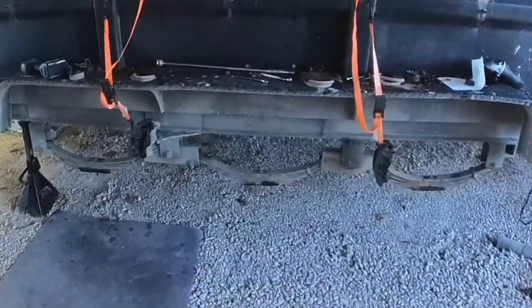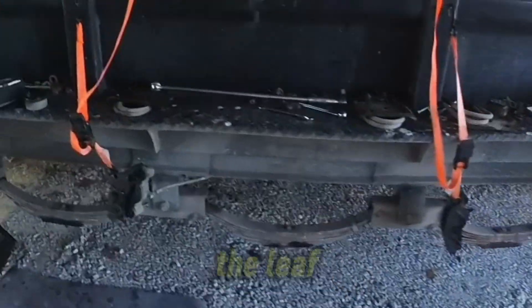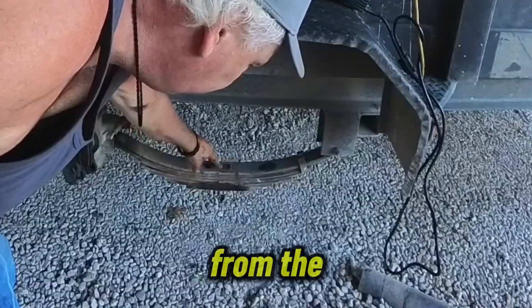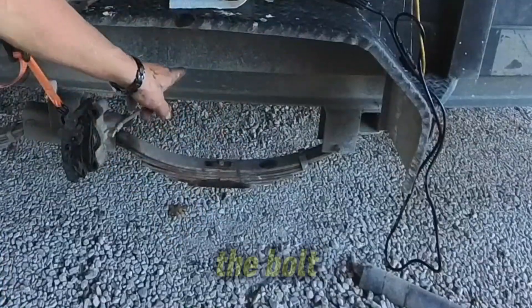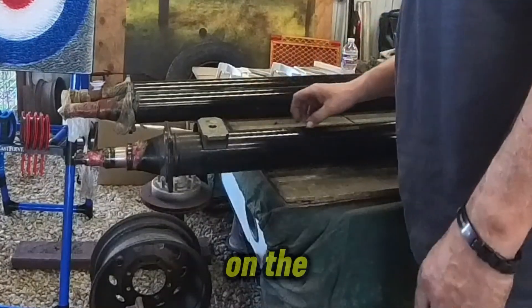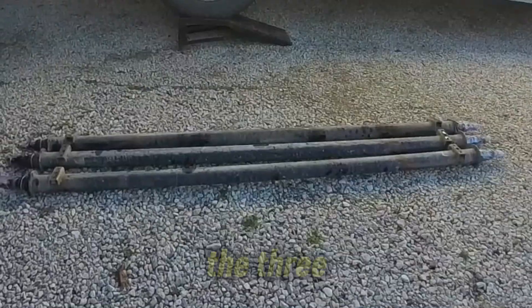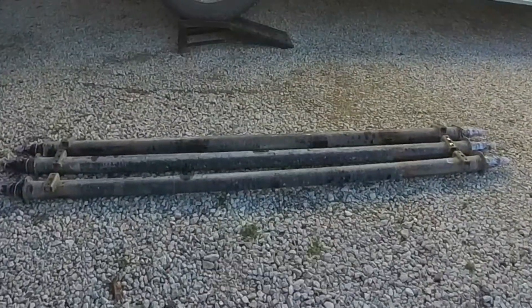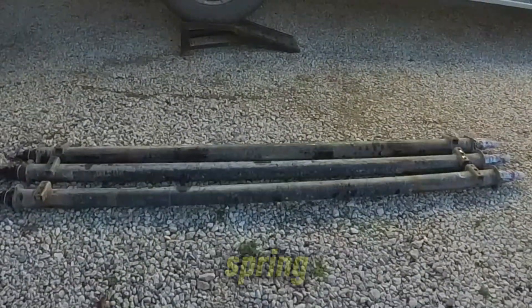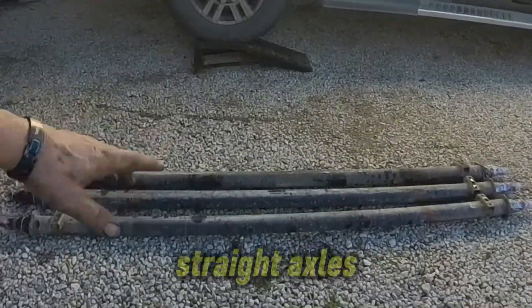All right, we've got three axles pulled off. When it comes time to put the new ones on, make sure you weld the leaf spring saddles on the new axles — measure from the center of one bolt to the center of the other bolt before you weld them. I don't need an axle flipping kit because I'm using straight axles. The three I just pulled off are also straight axles, so I could have unbolted them from the top side of the leaf spring, flipped them over, and hung them underneath. No problems — these are straight axles.